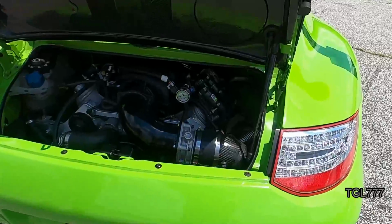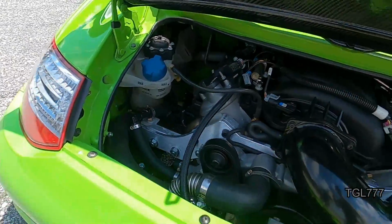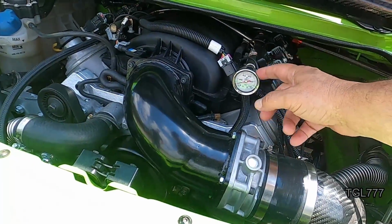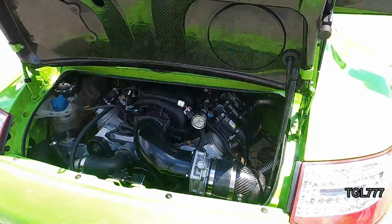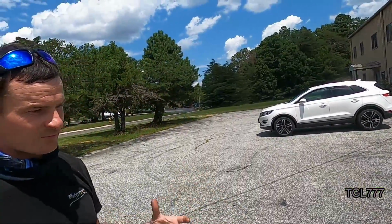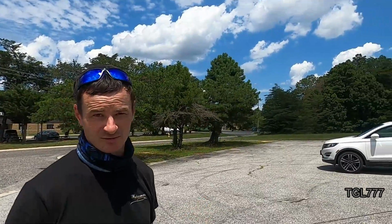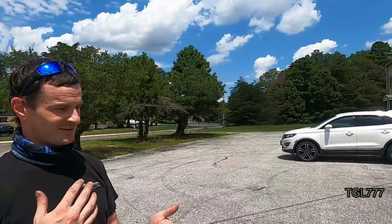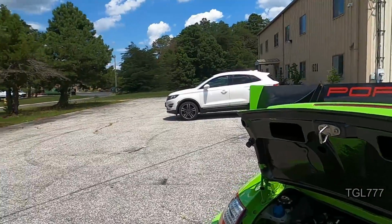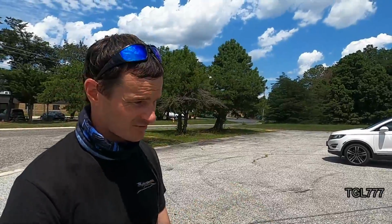Great, there's room for everything. The oil dipstick is there, right? Yeah. And this, I'm assuming, is a fuel pressure gauge? Yeah, and that's more for when we did the first start and for breaking in the motor. The way the GM Performance computer works is that it doesn't have a fuel rail pressure sensor in the computer. What it's doing is the computer is just relying on a 58, I think, PSI. It's already trimmed in the computer. It's always going to stay that way.